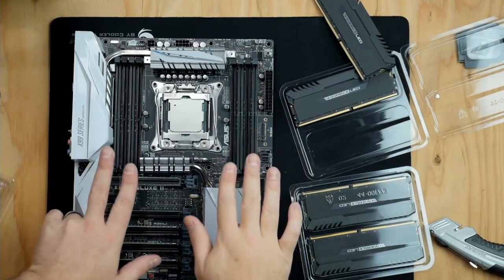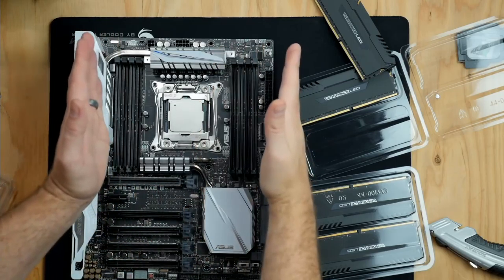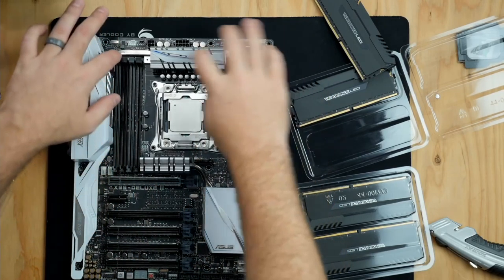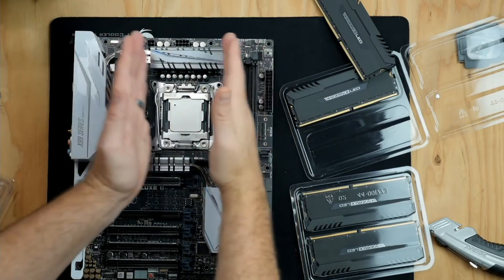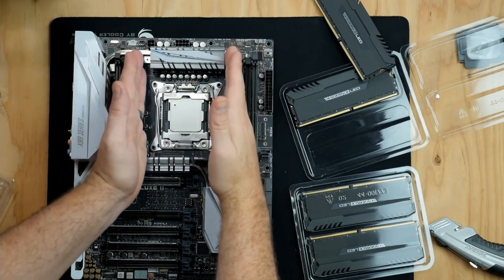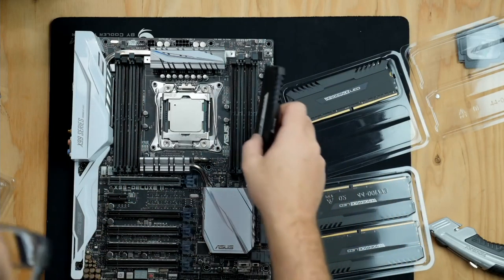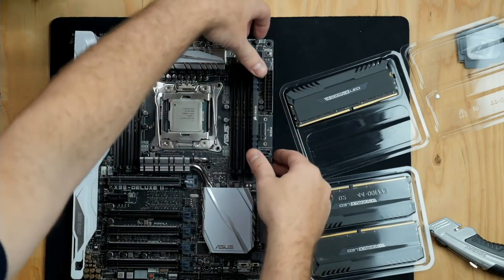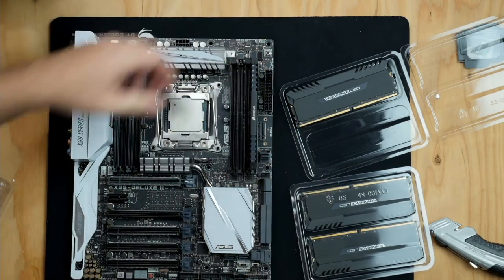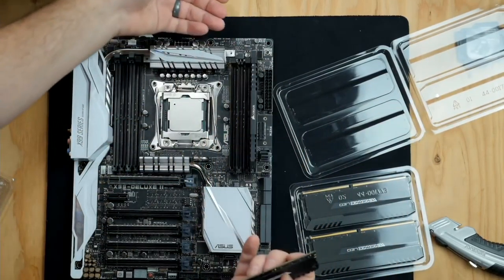All right. Asus boards, and actually most motherboards these days, will use the outer bank of memory slots. That's just to give you, if you have two sets or if you're not using all the slots, a little bit more space on the inner bank. It's a thoughtful thing of them to do. I forget when they started doing that. But yeah, we'll just line these up one at a time. Firm pressure from the top, and it snaps in. Those little side pieces should just...